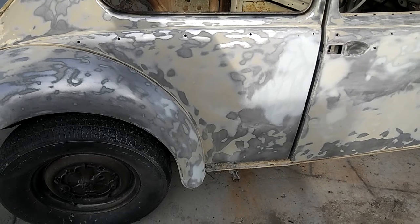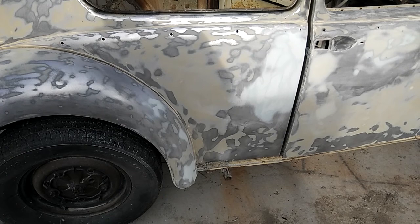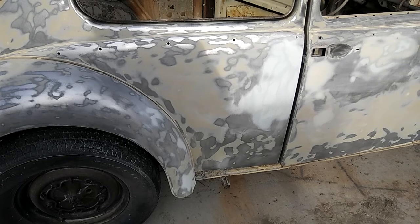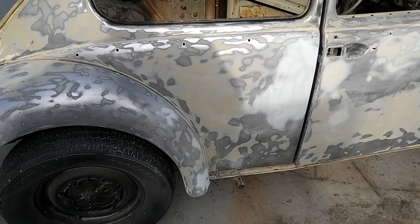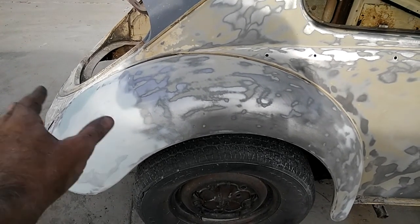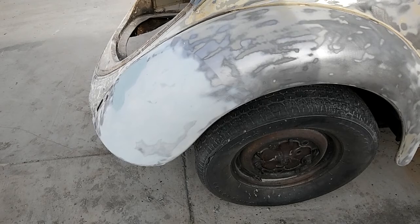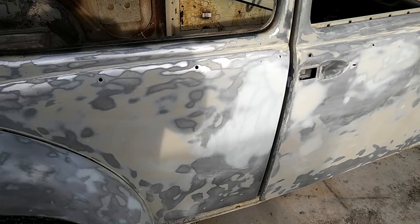I did the first coat with the cheaper Bondo. So I'm kind of working all three products right now, but I don't know if I'm going to be buying the cheap stuff anymore. I think I'm going to switch to Z-grip as a base because it just seems to work really nice. I'm not sure. If I have a lot of Bondo work, I'll probably get the cheap stuff for a gallon here and there. But if it's just thin coats of Bondo, you can do this stuff fine. But what I do is I just sand off most of the first one anyway. Like this one here, you can see the other color. I just basically hit it with the grinder, and then that's just a real thin coat of Z-grip. So it's like less than a 1/16 of an inch.